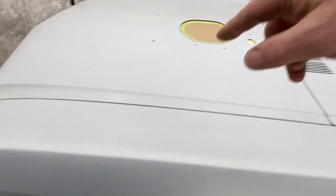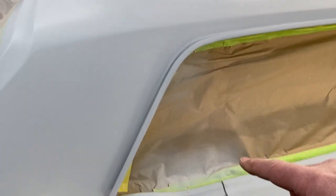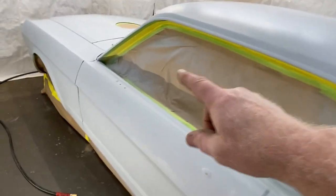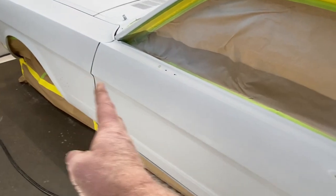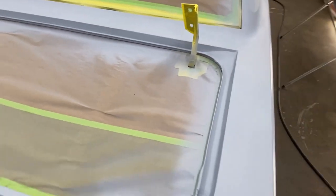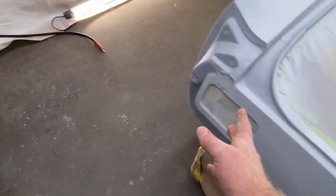Then I paint over the top of the hood, down this side. Then I do the door from the bottom up, taking it to somewhere in here, and then go up over the top. And then pick up this door here, come back this way and do the whole quarter. Then across the deck lid, the rest of this quarter, and the back. And that's the order of things.